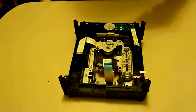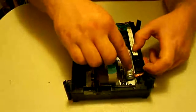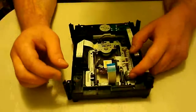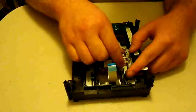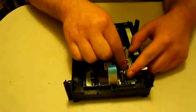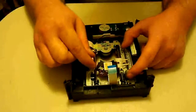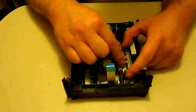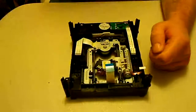This is the worm motor — as you can see, it's got a little spindle on there like I was talking about. One of the big giveaways that this is your problem is all the noise it makes. The reason it makes all that noise is because this arm, if it's not moving properly, or if it's somewhat loose and broken, or if the worm motor has gotten out of the actual track — it'll start losing traction, start slipping, and make clicking noises and other loud noises.